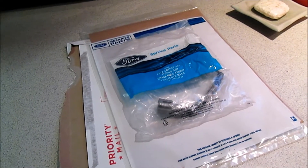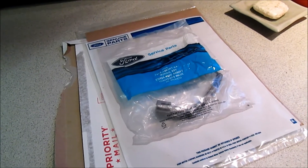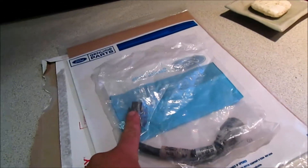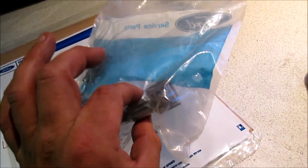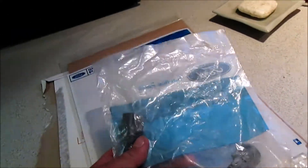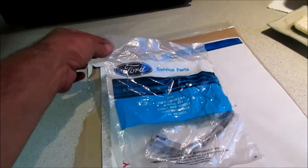How are we doing everybody? I got some parts here for a little 4x4 conversion update. First of all, we have our little 4x4 indicator light harness. This end plugs into the shift position switch on the transfer case, and this plug plugs into the plug that is by the tail end of the transmission. This harness will allow me to have the 4x4 and low range lights on the cluster — plug-and-play operation.